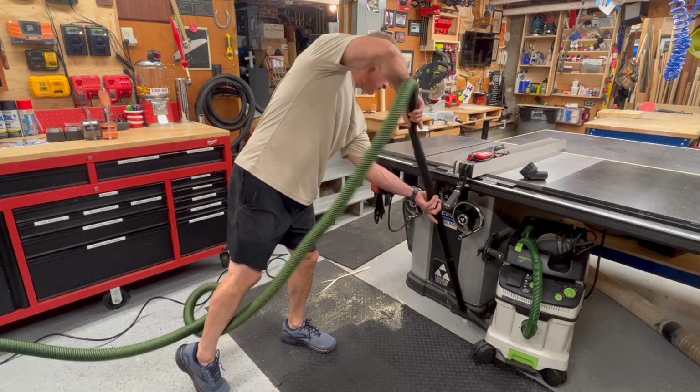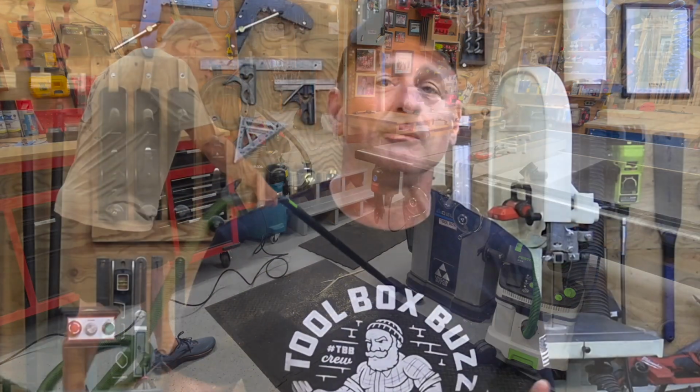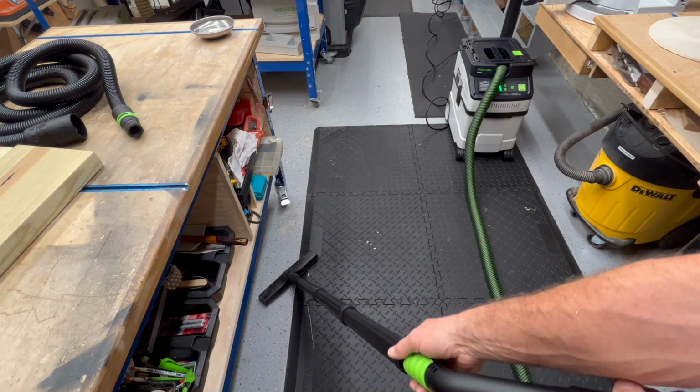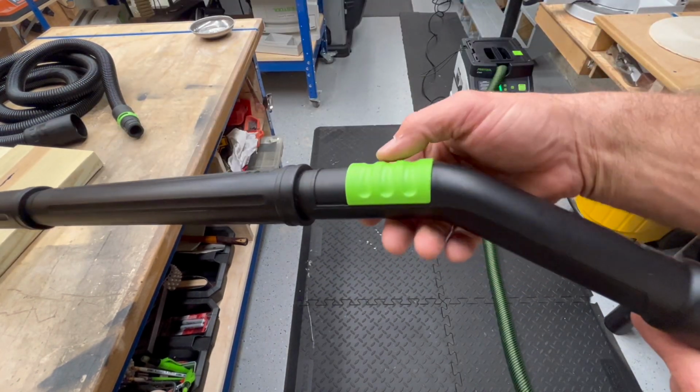We also noted that when I was using the vacuum, I tended to grasp the vacuum wand or the top of the connection there in different locations, causing some mixed results. It depended on what I was doing. If I was leaning or switching hands, if I choked up too far, my hand would accidentally push open that bypass nozzle if I choked up away from me.